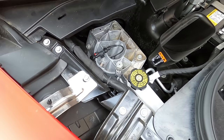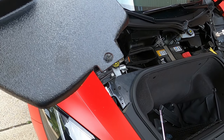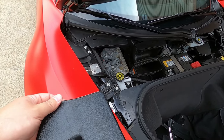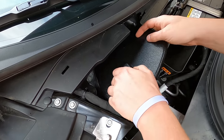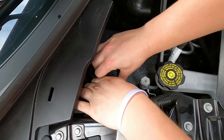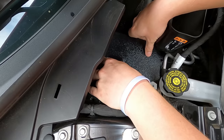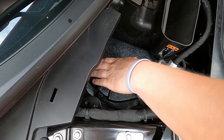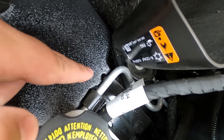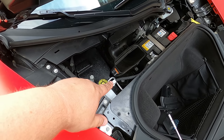The passenger side is a little more difficult because it's going to run into the end of the AC line. There's 3M tape on the back that will stick it in place. In a loop on the cover, there's a zip tie that they provide — you actually zip tie it over top of a piece of the AC line. It's pretty difficult to get in there; you have to put it in at a certain angle and then twist it into place. You'll see it kind of pops in and you just twist it until it's perfectly covering the strut mount. The passenger side is a little tighter than the driver's side, but you will feel it once it's in place. On the MagRide car, you can see it fitting perfectly over top of that MagRide wire, then you zip tie it to the AC line.